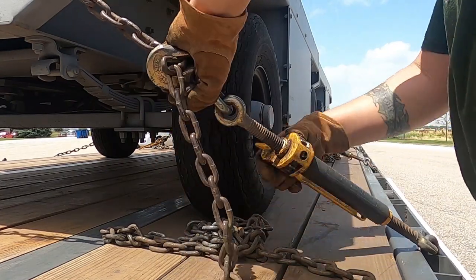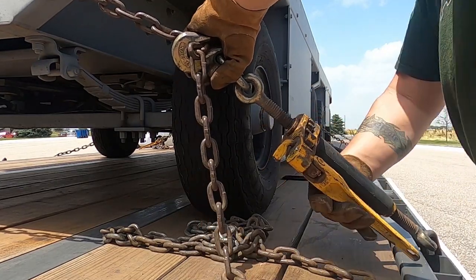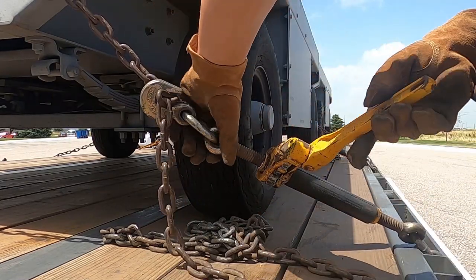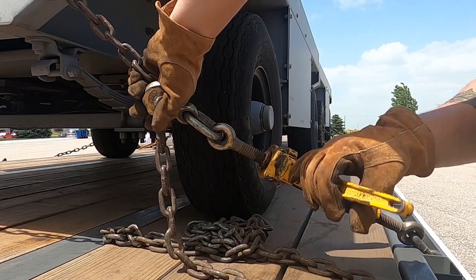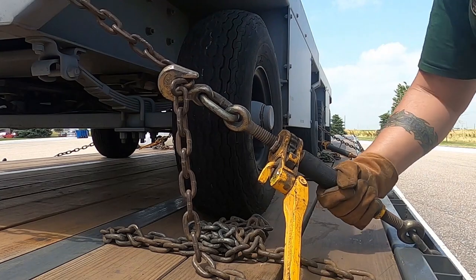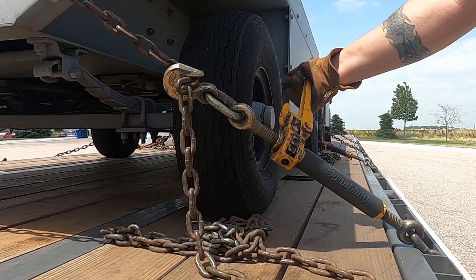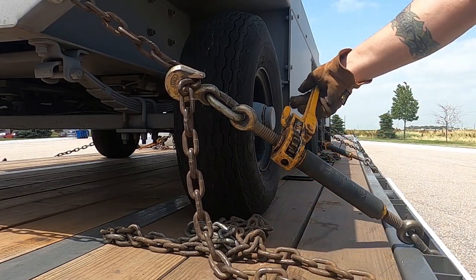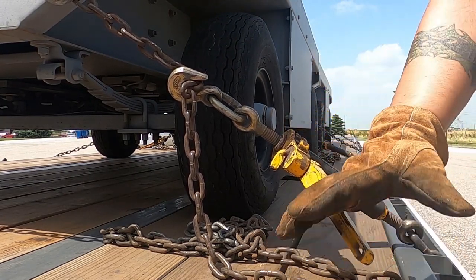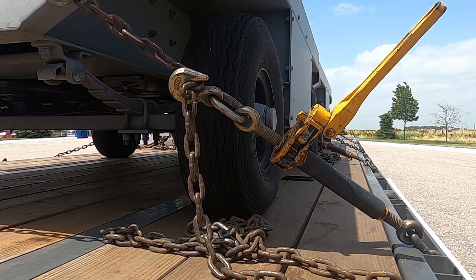It's having a little issue here. These chains are going to get rusty, especially exposed to the weather — which brings to lubrication. I like using the white lithium. It's not as runny as WD-40 and it doesn't collect as much dust. WD-40 is crazy — all it does is it's a dust collector. The white lithium kind of goes on more, it dries. It doesn't seem like WD-40 ever dries. You can actually see in the top left corner you can see it start to compress the suspension. And then look at the tires too — you'll see the tires start to flex a little. And then once they start flexing, that's plenty for that point.